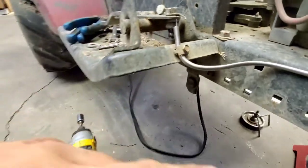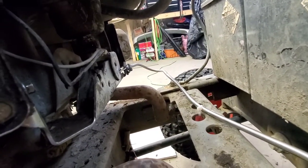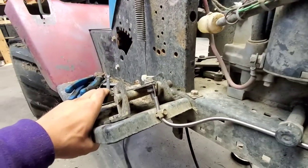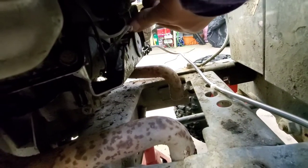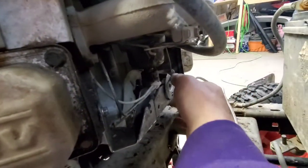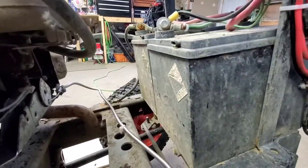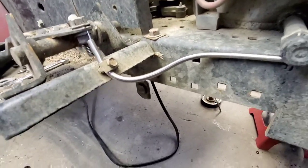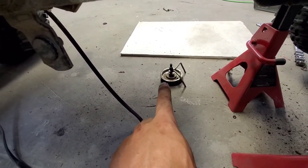The cable is wrapped around three times and came out way over here so I just cut it, but it won't retract back because I need a spring. It's still wide open throttle - I just need a spring to pull that back down. Up front I've got my battery sitting there. I'm going to find a spring and put the new pulley on - not new but better than the other one.